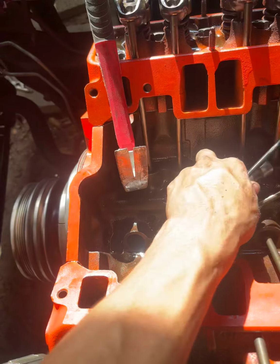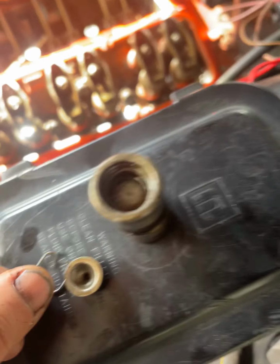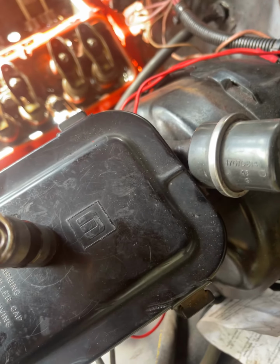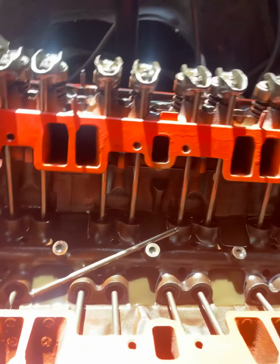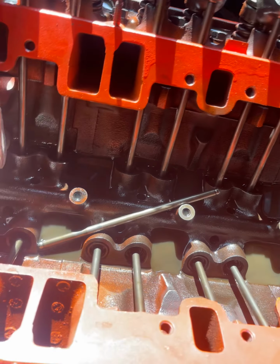Now I'm like, you know what? It might could work. The top of a lifter, you see I already changed it, the top of the lifter has the lock piece on there and this little thing that goes in there, boom. And then the lock and whatever. So anyway, when the lifter's in the car, it's stuck because of all this carbon buildup. It don't want to come out. So it's stuck all in there.